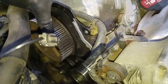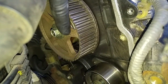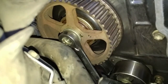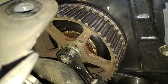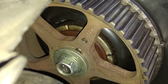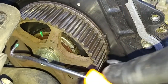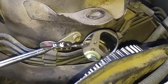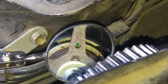Now we have to move the camshaft to top dead center. That means rotating the camshaft sprocket until this hole over here matches a notch right around here. I'm going to rotate this until I get that center mark aligned — you can see the little groove right over here. I'll put a little paint mark in there too. It just snapped right there, like it wants to snap in place. Using this mirror to see if the hole's in alignment — and it is. You can see the little green paint mark. We're at top dead center on the camshaft.